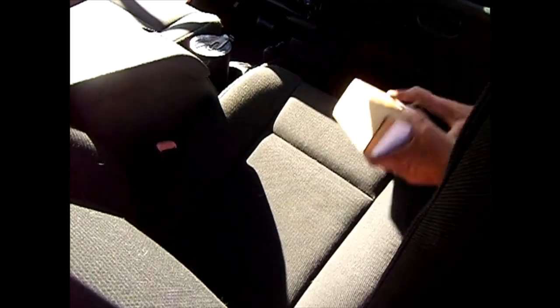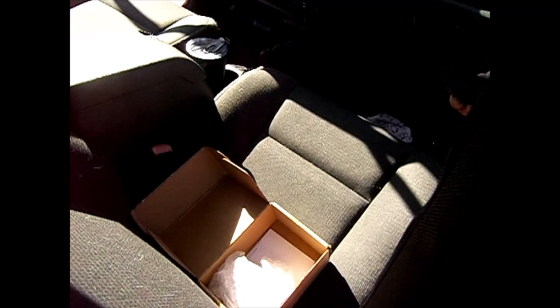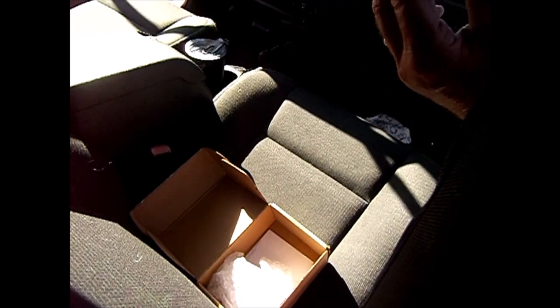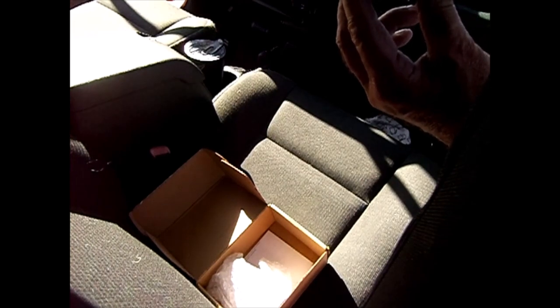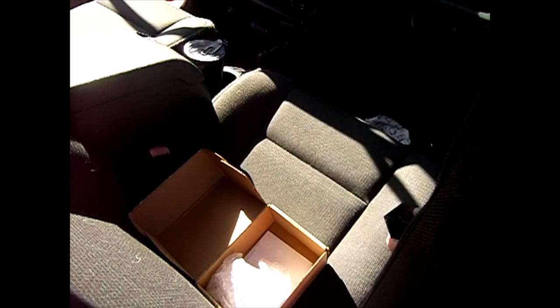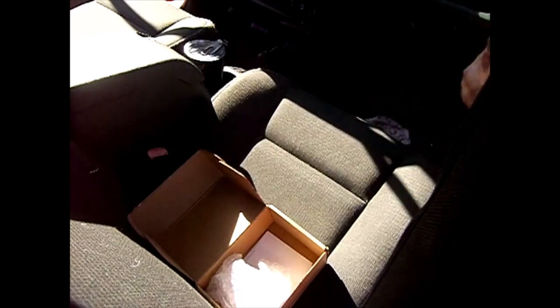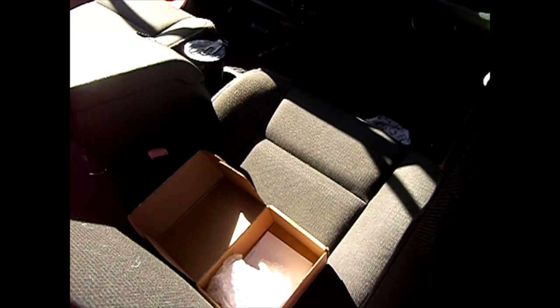Okay, what we've got here: we got three two-inch tall blocks with smaller holes, and then one with a bigger hole that uses a 16 millimeter — or I found out that a 5/8 works perfect on that. That's the bolt that was originally the T50 torx, so that's the one that goes in the left rear corner as you're sitting on the seat. The other three are 13 millimeter. One thing — the washers that came with the 13 millimeter bolts are way too small; they'll pull right out of the railing. So I bought some backup washers.